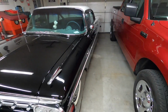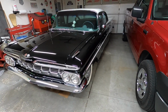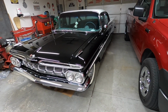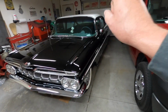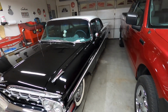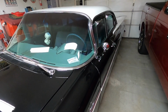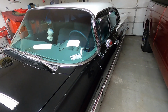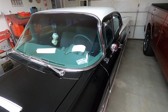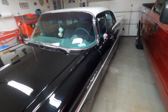We'll get that rear center valance off next. I think that is going to be my next little odds and ends. I'm just going to fix a lot of little nickel and dime odds and ends on it, and that's one of the things I want to do this winter, along with the grill screen moldings. I've been looking into seat fabric, but can't really find anything original reproduced. I guess I'm going to call SMS, but I've hunted around for new old stock at some old upholstery shops, and they've long been out of it. So I'm probably going to at least pull a seat and refoam it, pull the covers off and put in new padding and everything, because the padding in it is just beat down.